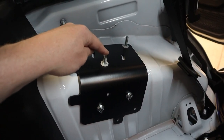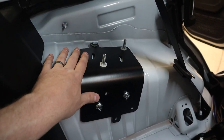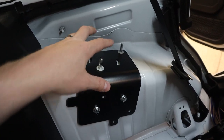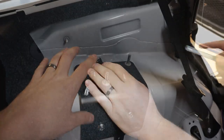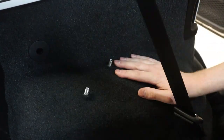Next, I need to make sure I have a hole for these two spots to pass through the carpet, because these two bolts are going to allow us to mount the subwoofer enclosure. To cut the holes in the carpet for these bolts, we carefully position it in place, feel for the bolts through the carpet, and use a sharp utility knife to cut a slot.